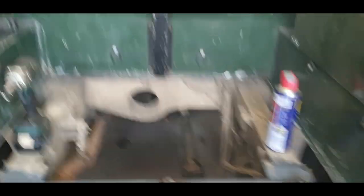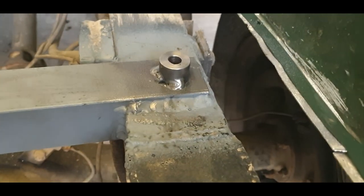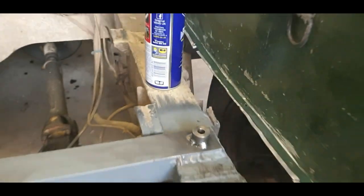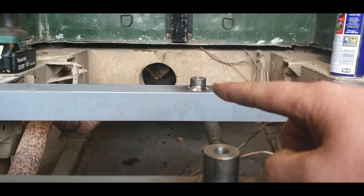So it's been a while since I've done an update video — I keep forgetting about doing these things, but we'll get there. So I'll show you what I've done. It's welded in both sides now. I'm very happy with the welding — it seems to have penetrated really well, and down the sides as well. Here are the bushes that Taff made for me. These are 32mm at the back and then 18mm up at the front, just because the chassis obviously drops a little like I said earlier.